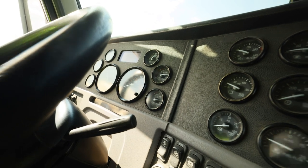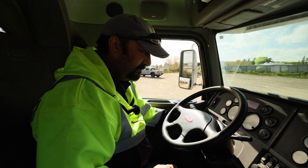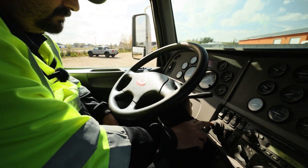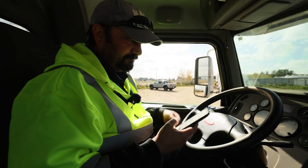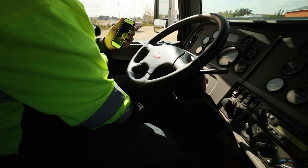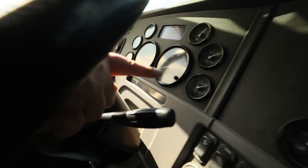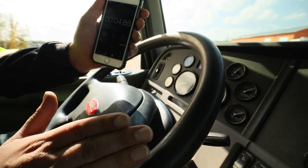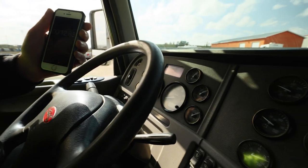We're now going to go to the cutout range again of 120 to 135. There we are. At this point, we want to check the entire tractor-trailer unit for leaks. I'm going to shut the engine off and put the key back to the run or power position, and be patient — let it cycle through again. Now we're going to do a leak test. Get your timer ready for a two-minute leak test: I'm going to do a full service brake application and let it stabilize for a few seconds. The maximum we can lose is four PSI on the tractor and two PSI on the trailer.